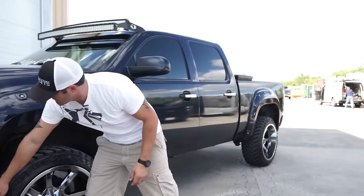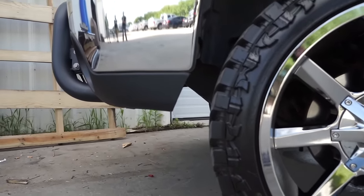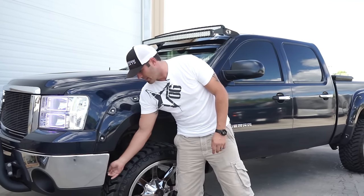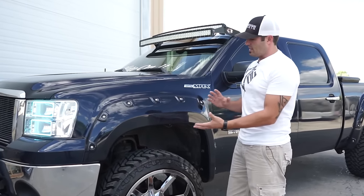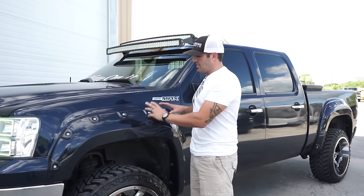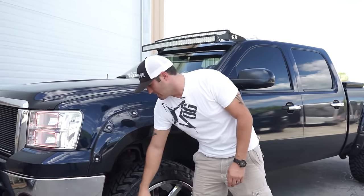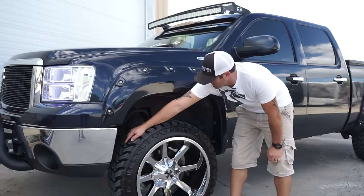And then up front here, Junior, you can just see, just had to come off some of the valance. Some trucks will actually get into the bumper on this exact same setup, where you'll have to also trim that chrome bumper, and then you wanna make sure and go back and put clear coat where you trimmed it. It all depends on the truck, because what happens is, it's a thing called tolerance stack. As you start having different tolerances in the suspension, the same exact truck off the same assembly line, that whole front end can be shifted up just a tiny bit, and that little bit is what causes it to hit when you go to crank the wheel. So of course it also has the trimming up front here.